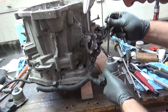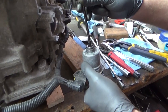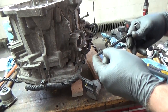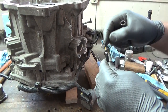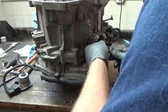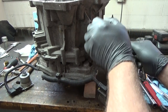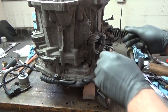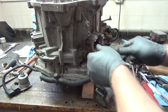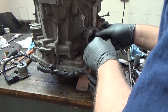It's a spline, like so. I measured it up and felt it. It's really close to 6 millimeter. Now I won't be catching every spline, but I'll be catching every corner. And it slides in really good. I had to take a file to it just a tad, and I had to grind the nub. It was like a ball socket that wouldn't work. So we got that slid in there.